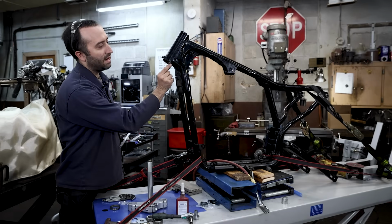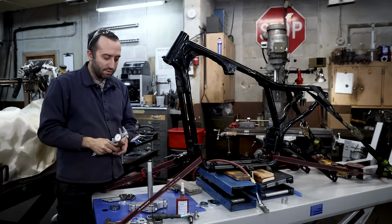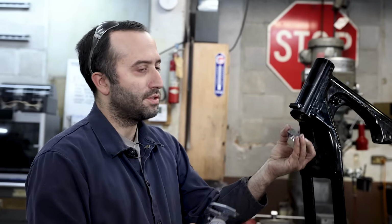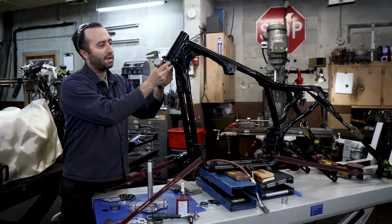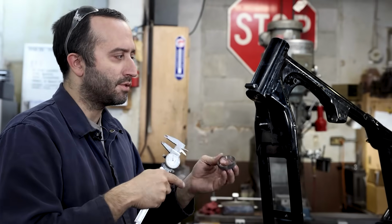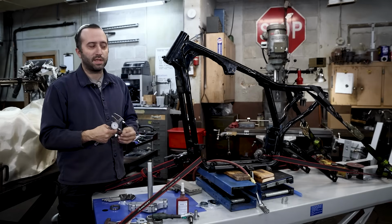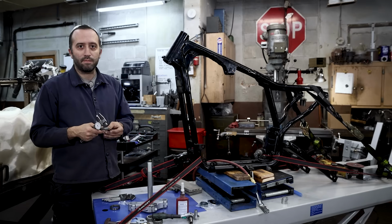So we're just going to sand away a little bit in the back or the front, whichever you have chosen to wear the slot in the bottom of the tree. So if you're going to mount it forwards or backwards, and I chose to mount it in the back, we're going to grind a little bit away in the back to have a relief for this. I'm going to measure it and make sure that I have enough clearance for this to seat before I start to press it in, because then you're going to have to beat it out again if you don't do this properly.